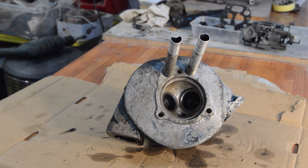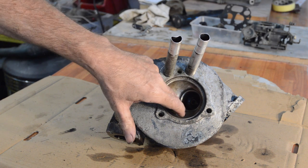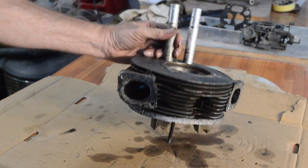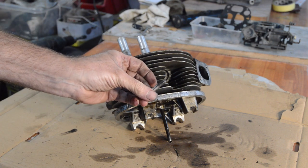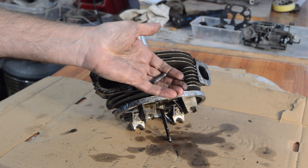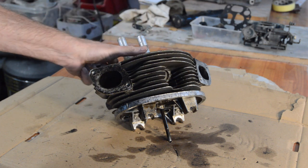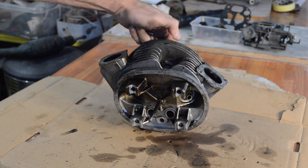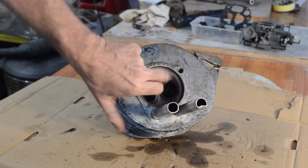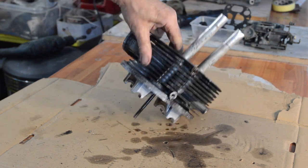Let's look at the head. The spark plug thread is okay. The seats we've got to clean up. I've got a broken stud out of the exhaust — we might show that being done on another head later on, but not for the minute. Everything's good; even the mounting bolts underneath have got good threads, nothing's stuck in them. Happy day.